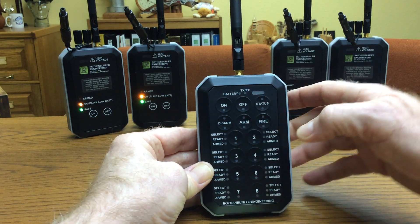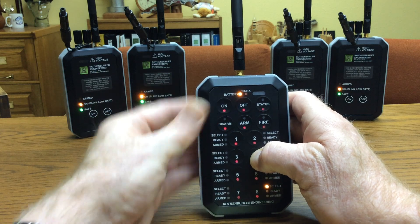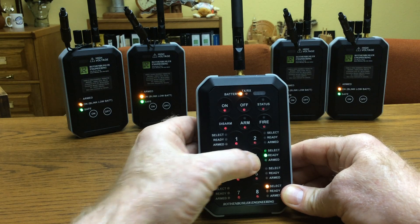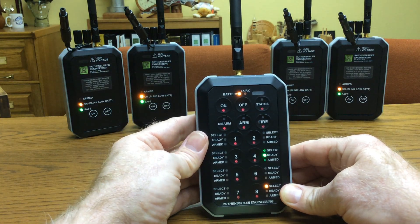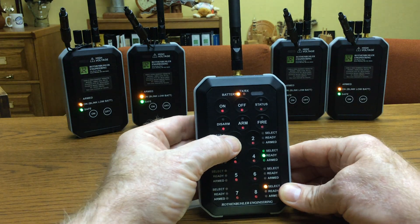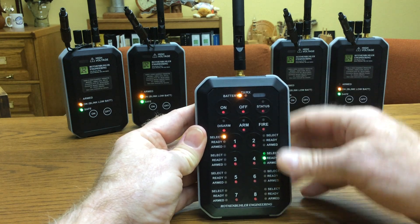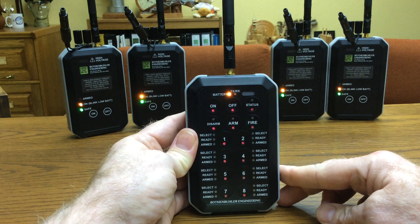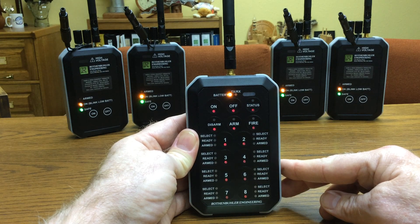Just a quick review of that: I push and hold the four button, turn it on, and hit the disarm button to enter programming mode. I put it back to the on position and push it again, and then I can set my timing — I'll set it back to half second. Lock it in with the status and cycle the power. That's how you turn it on, turn it off, and set the timing.